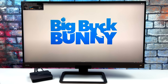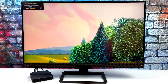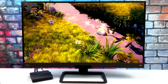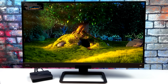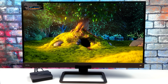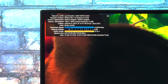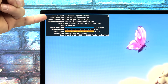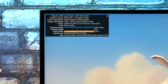Whenever I test out 4K video playback on these little mini PCs I always like to turn scaling completely off with Windows so that we have a full 4K viewpoint. This is a 4K 60fps video — I will have stats for nerds up in the top left hand corner. I'll zoom in after we get to about 6,000 frames, but I want to show you how well this does run 4K video. Overall I've been really impressed with this little chip. The new Jasper Lake Celeron CPUs are actually really good — low power consumption and great 4K video playback. The N5105 has that higher end GPU built-in with 24 execution units, same thing with the N6000, but the N5095 only has 16 and this does make a huge difference. Our current resolution is at 4K, we're running at 60fps, and so far we've only got 11 drop frames — you'd never notice those without a frame counter.